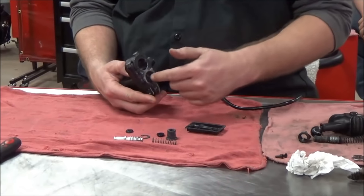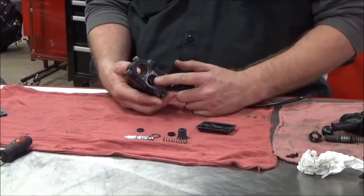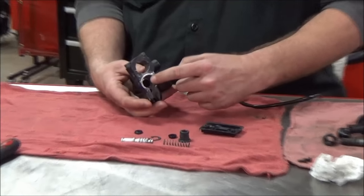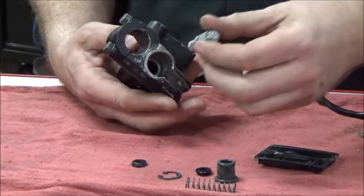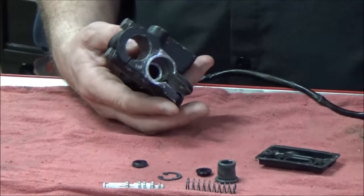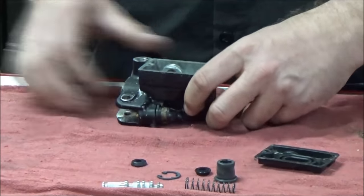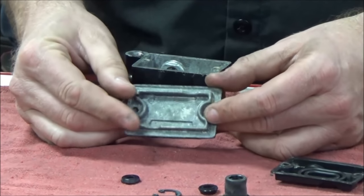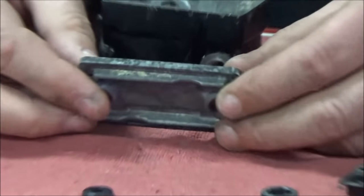There are tools out there specifically sized for this called a brake hone - I showed you guys that in the lab. What we're looking for is making sure that our bore down inside isn't pitted, because the piston won't be able to seal if we have big heavy pits in there. The assembly needs to be super, super clean. Think of this as hydraulics - we don't want any dirt or debris to fall in there.